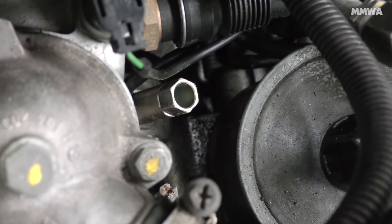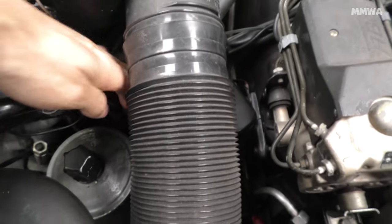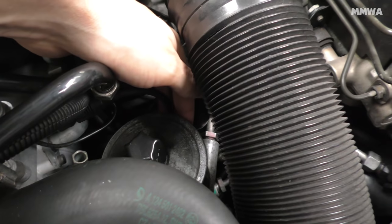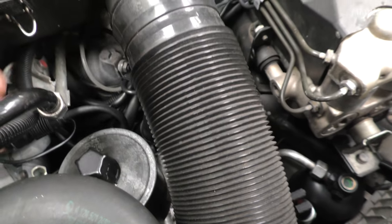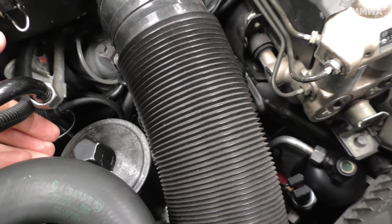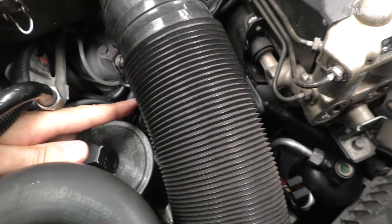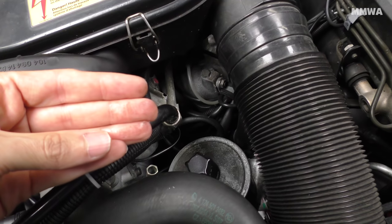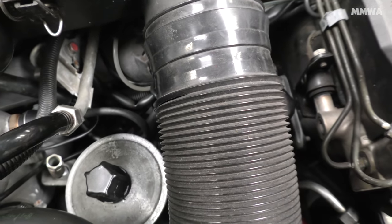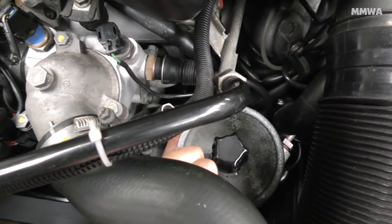I don't believe it's leaking from the lid, because it's not overly wet on the sides of the tank. I mean, it is slightly, but nothing overly concerning. That may have just been residue from spilling it while filling at some stage. And I may, of course, run it slightly over full as well, meaning some may have splashed out of that vented cap. But overall, this pump is very leaky, and resealing it is the best possible outcome.